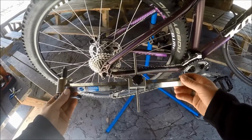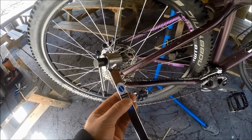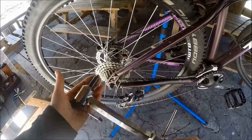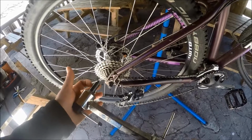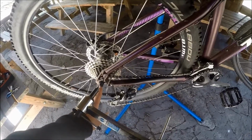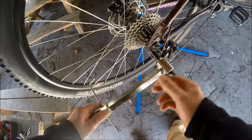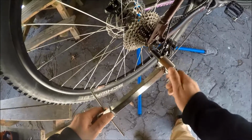Okay, this is your derailleur hanger alignment tool. Derailleur alignment gauge, I guess, is the new school, 2.2. Well, I would highly recommend getting this 2.2 version because this has a longer shaft on it, and some of the other ones don't have this. And the newer bikes, the older one will work on this one, but the newer ones, some of them are hard to get to. Okay, be careful when you thread this in. Okay, if it doesn't just slide right in, then don't force it. This one's kind of being particular, so there it goes.